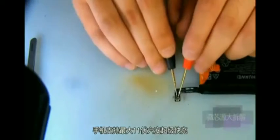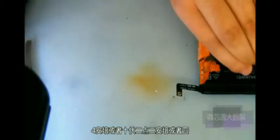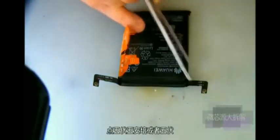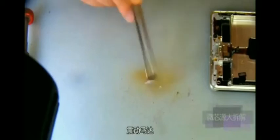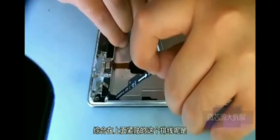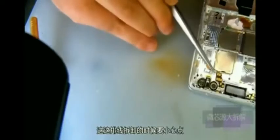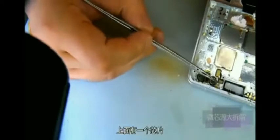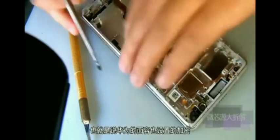The phone supports a maximum of 11V 6A or 5V 5A or 5V 4.5A super-fast charging. This is the vibration motor, which also supports Huawei's face unlock feature. This is a comprehensive connection board — the SIM card slot small board is connected to the motherboard via a cable. When disassembling, be careful: there is a chip here. It is a super-aware camera encryption chip — that is, Huawei's face ID is also set up with encryption.